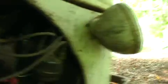Since this was a positive-ground tractor, we had to switch that over to negative ground. Also, don't use the same coil connections — you need to swap them over. Your positive needs to go to positive and negative to negative, not the other way around. Basically your positive will now be on the ground side since this used to be a positive-ground tractor and is now a negative-ground tractor. That's pretty much it for the conversion itself.